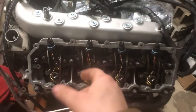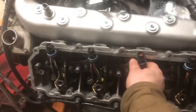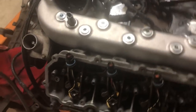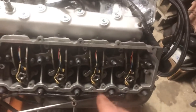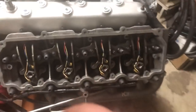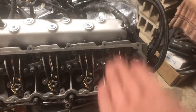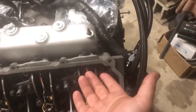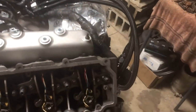And then we are going to oil up these ones and then pop these through our rocker box holes up there. And then we can start getting the oil rails on. Quick, guys, I just wanted to comment, after you lube that O-ring and you stick those up through there, one thing to be sure: each of these has a little barcode on it. Make sure that is facing this way when you push it up through. And then once I get it aligned and push it up there with my hand, it can be tricky to pop them all the way through.